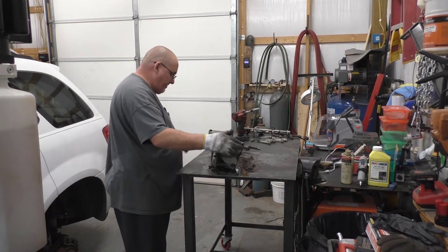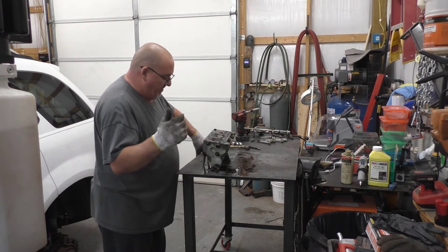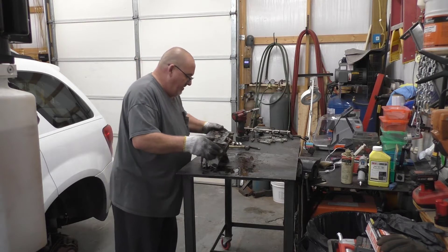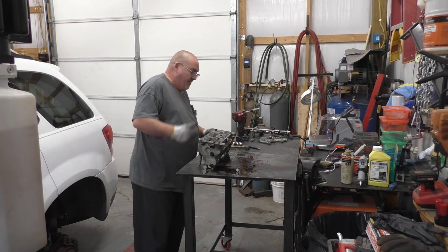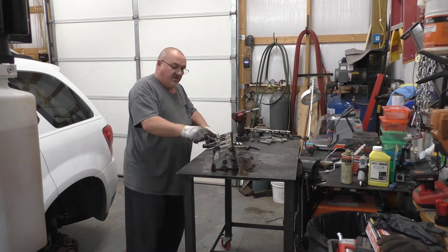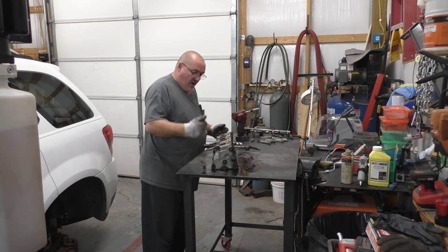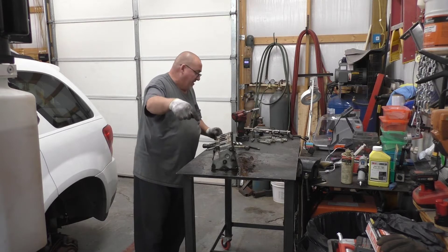Here's the other head. I really don't think there's anything special about it. Looks like this one here may have been leaking. Impact is very important when you take your exhaust bolts out — these studs, in my experience, most of the time the whole stud turns out. Don't forget to take the temp sensor out of it.